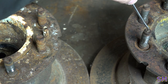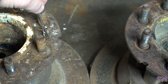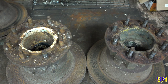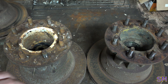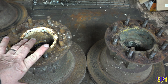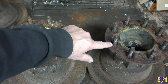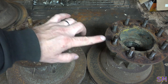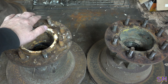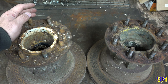Because there's two different designs here, I have to run two separate rims. So why am I upgrading this? Well, a bit of a spoiler alert. When we get into the rear brakes, one of my outer bearings is actually spun on the hub, meaning the hub is no good. I can't find another set of rear hubs from the old style. I had to buy a used set on eBay, and they don't look all that great either. However, they are the new style.